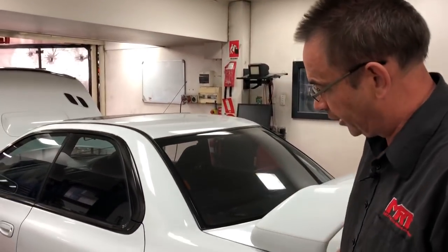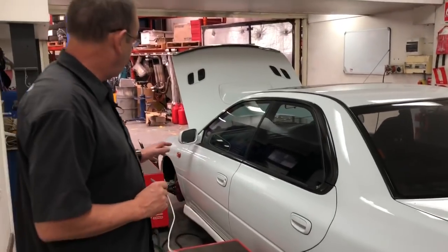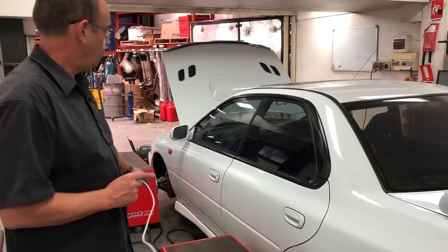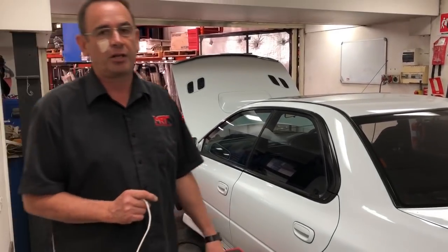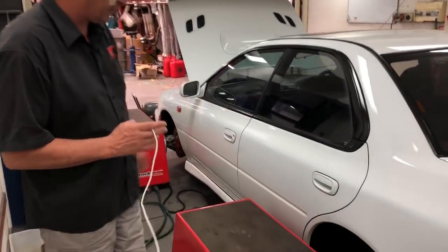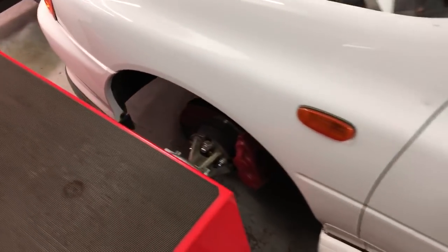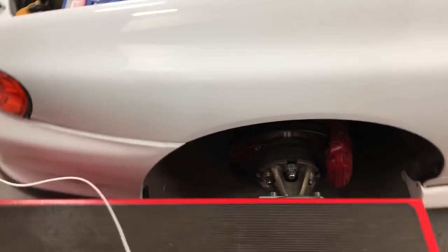The difference between the Version 6 and Version 5 STI rear wing — 1999 to 2000 — is something I know really well from when these cars were competing in Group N in the Australian Rally Championship. Scrutineers would look for exactly these details depending on what year model you wanted to run. This is definitely a 2000-model rear wing with that additional lip for more downforce. The STI also had different rear brakes; someone has painted the fronts red and it's got DBA slotted rotors front and rear, and we're going to give it a refresh.